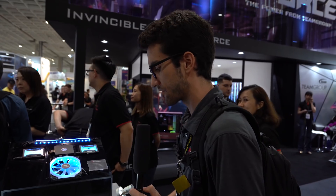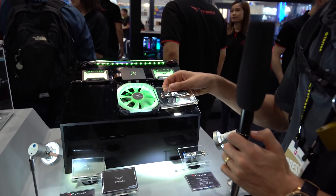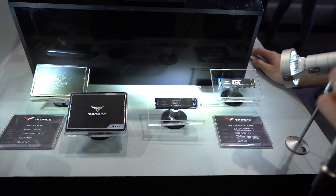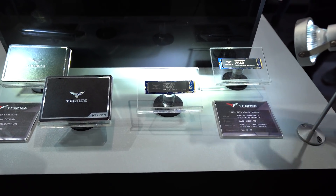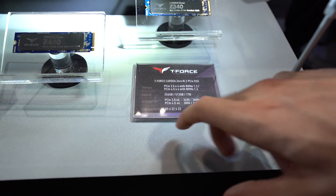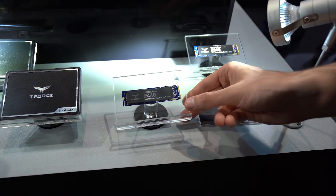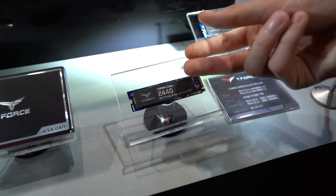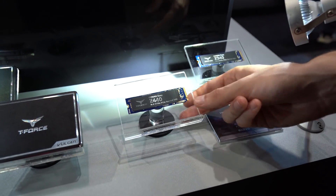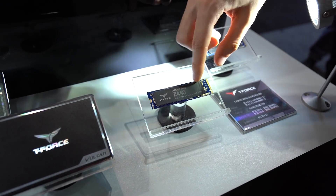Now, an interesting note about M.2s as they relate to PCIe Gen 4. This is a PCIe Gen 4 M.2 here. When these things run really fast, like around 5,000 megabytes per second, they get very hot. That's one of the reasons why the speeds on this one are 3,800 megabytes per second reads and 3,200 for writes. The drive doesn't have a very beefy heatsink on it — a lot of drives running at 5,000 MB/s reads will have very thick heatsinks. The one from Gigabyte had a large copper slug on top and copper underneath. In this case, we have just a graphene slab that's supposedly really good for heat dissipation, but it's just one little slab on top of the PCB.